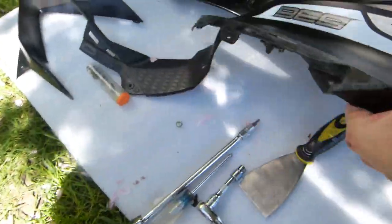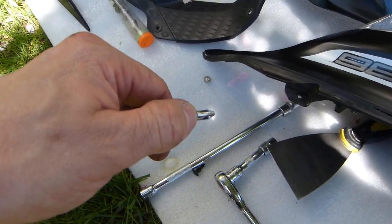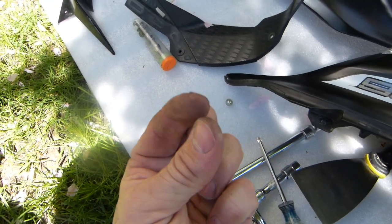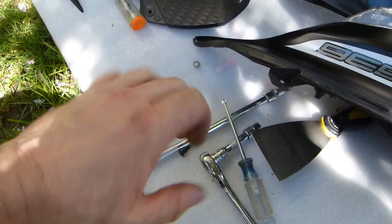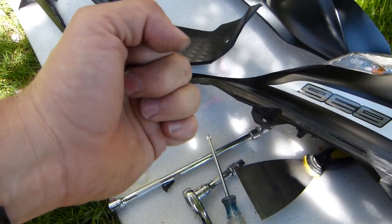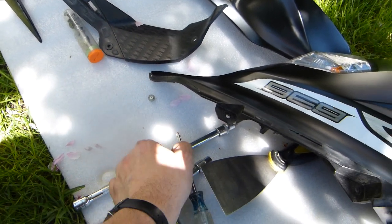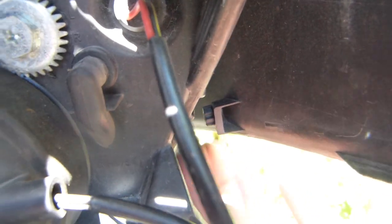And I had to tighten it, not with a screwdriver, but with a wrench. This is the screwdriver that doesn't fit. Just take a screwdriver bit, and I worked on the screwdriver bit with just an 8mm wrench, or whatever millimeter wrench can grab just the screwdriver bit itself. So you kind of make up your own screwdriver with a small enough wrench and just the screwdriver tip, in order to fit your hand and wrench just here, to get this bolt tightened. Okay, so that's where the second bolt goes.